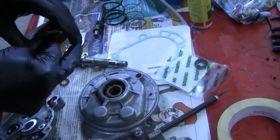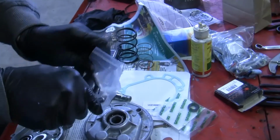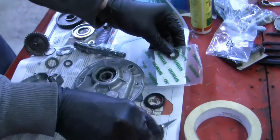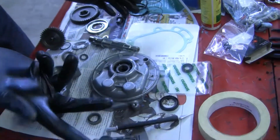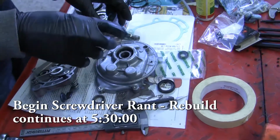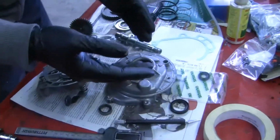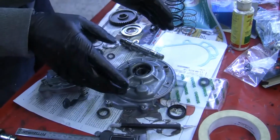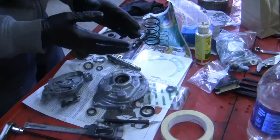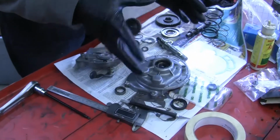We are going to put this back together with Allen bolts because I'm putting the whole bike together with Allen bolts because, as somebody mentioned earlier in one of the early videos, they are not number three Phillips screws. He's technically correct, but for the most part, it doesn't really matter, because he referenced them being JIS, which is a Japanese Industrial Standard of the Phillips style, like cross-headed screw. There's a lot of different versions of that. You also see like Reed & Prince, which is a pointier version and stuff like that, but for the most part, for the JIS versus the American Phillips style large diameter cross-headed screw, the difference is really pretty minimal on that size.